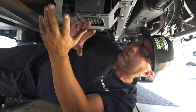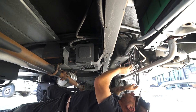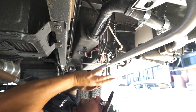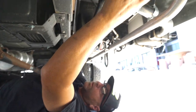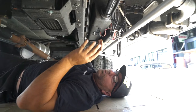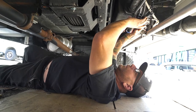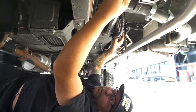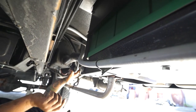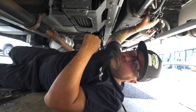Another thing I want to mention — I would encourage you to get under your motorhome and check, because as I come back here you're going to see a lot of loose wiring that's just kind of hanging here. This looks like it's going to be for your gray and black water tank. The problem is we also have our generator right here and our exhaust for the generator running along here. You're going to be super frustrated when your tank overflows because the sensor went bad. So I would definitely encourage you to get underneath it and check it. I know even when this RV came in, this was also hanging. We threw up a couple zip ties to drive it — I'm going to grab a couple more and zip tie this up out of the way. You just don't want to have problems, and it's better to spend a couple minutes underneath it.